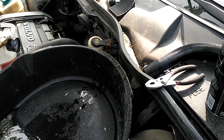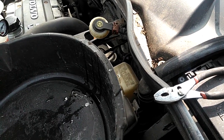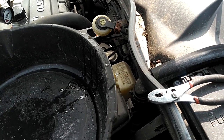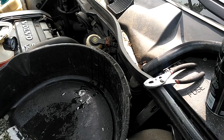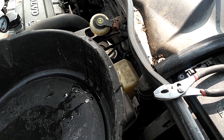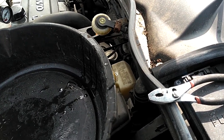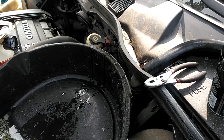In this video we're going to show you how to bleed the brake system — that is replacing all the fluid in the entire brake system from the reservoir back to the calipers. You also want to get all of the trapped air out of the system, because air in the system can cause the brakes not to be as efficient, since air compresses while fluid does not.